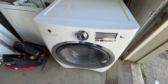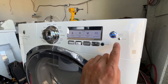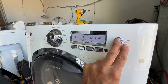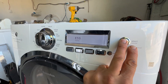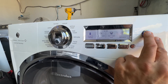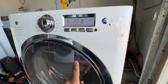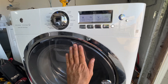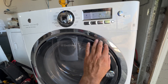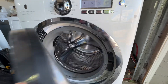Here's a useful trick: if you ever want to know if there are any problems with your washer and something isn't working the way it's supposed to, press the Cancel and Start buttons at the same time and hold for five seconds. Within five seconds it's going to show you the error code. On this unit it showed error code E59, which is for the motor. The bearing is broken on this unit, and because of that the washer is getting that error code.